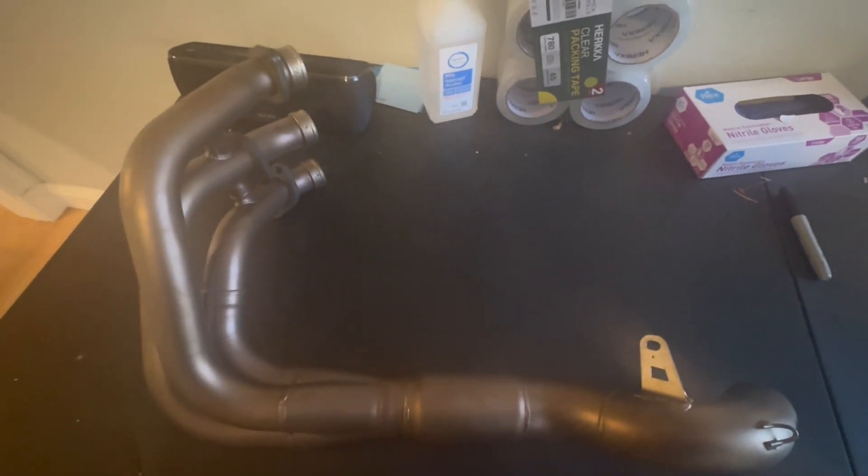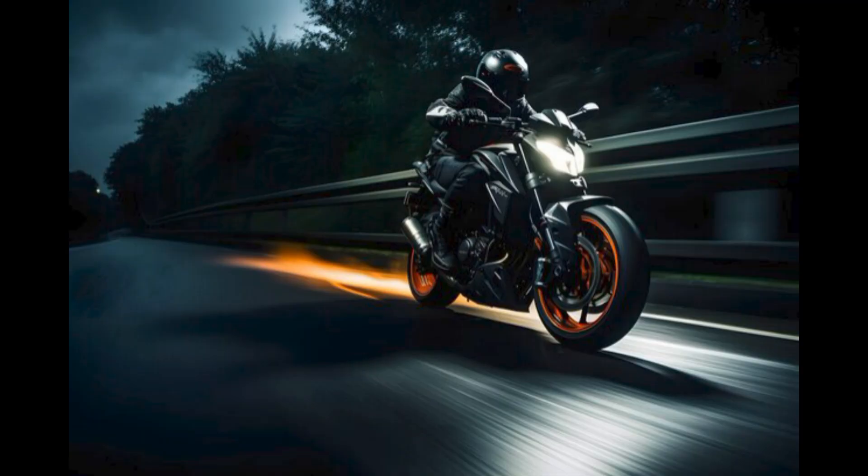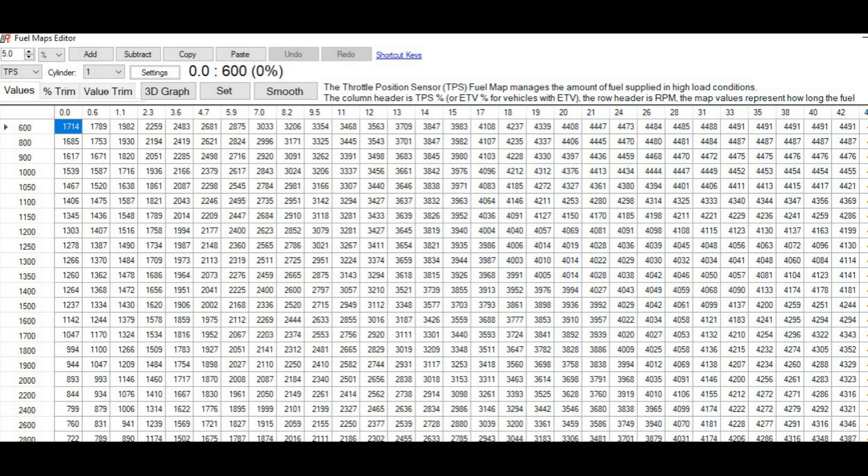I hope that wasn't too much talking in circles. So the next time you hear somebody talk about back pressure, you want to say: it's not back pressure that's the problem — it's the lack of velocity and losing the scavenging effect. Before I go, I'd also like to point out that it's not always true that you lose bottom end power when installing a full exhaust. On almost all of the bikes I've tested, I can put a full system on them and gain power from idle to redline.